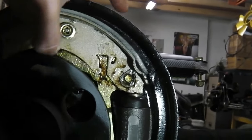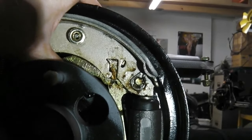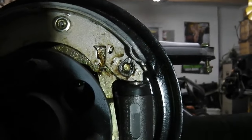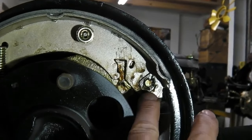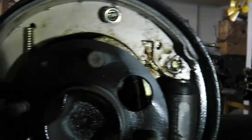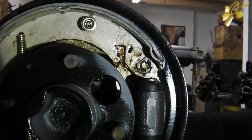And then you'll see at the back of this shoe, obviously I've assembled this on, assuming this is the trailing edge, otherwise I'd have to take this off. But on the back of there, this adjusting lever, the handbrake lever that I'm moving now, is held on with a horseshoe clamp. You can reuse them, but you're supposed to put new ones on. There's a pin through there, and that squeezes together, and then you've got yourself your adjustments.